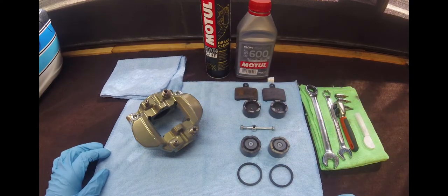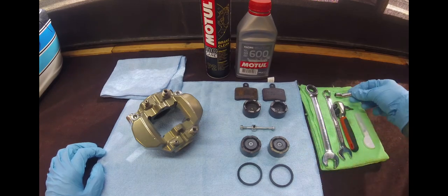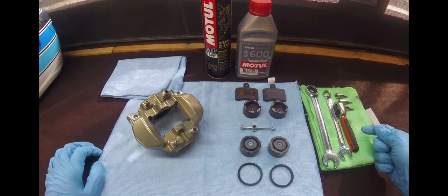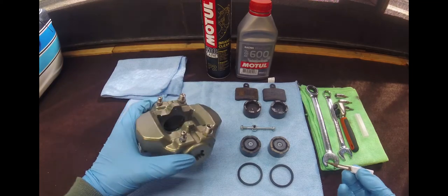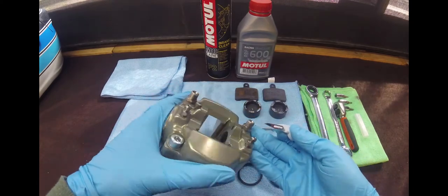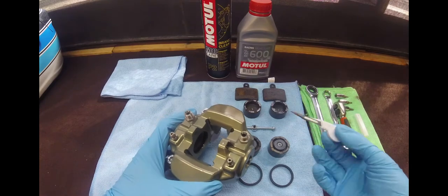From there, with the pistons out, we've used a 2.5mm Allen hex bit to swap over the magnets onto the new pistons. We've got new seals as well. To get the old seals out, I've got a small sharp scalpel here — you can use a number of items as long as you're comfortable with it. You're not going to damage the caliper, as we really can't have any scratches or damage inside here. A small sharp item just to pierce the side of the rubber and remove it should be fine.